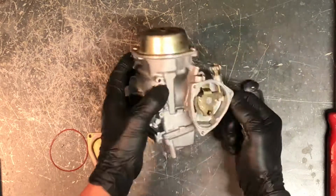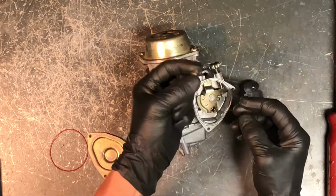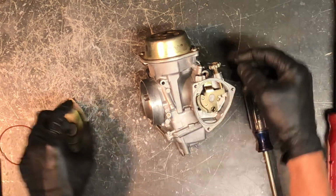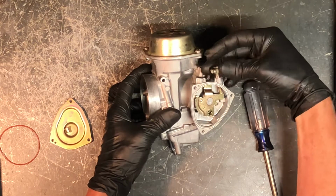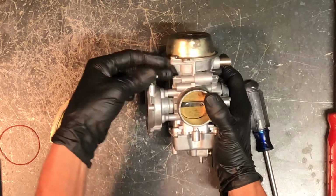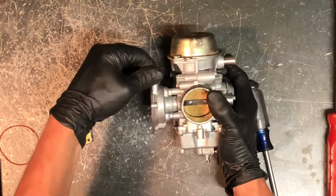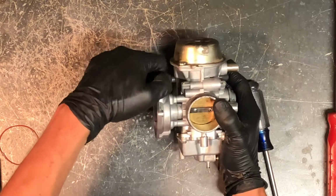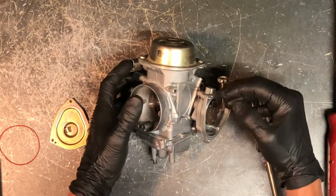and eventually that'll shrink down to where you want it to be. We've got your throttle cable that runs in here. It sits on this little clip here, and that goes in that groove there. So adjusting your idle is as simple as turning this thumb screw here, and all that is doing is opening up this butterfly. If we were to do a drastic idle adjust, this would be turning the idle way up. Clockwise is turning that idle way up. So that is the throttle cable part of it there.